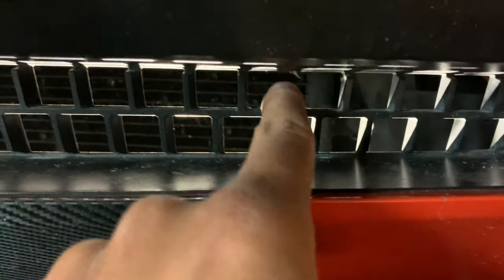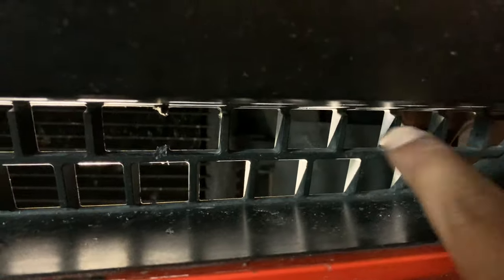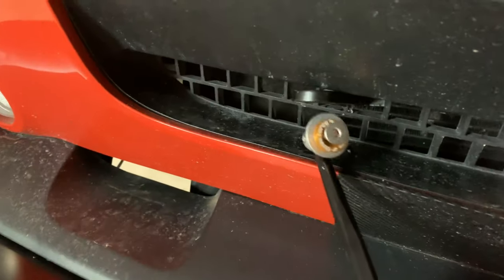What I did was I measured where it was gonna bolt up to the bumper support and I made sure it was even. For mine it was six of these little riblets in from the outside, and here you can see where I have it mounted up. From there the support rod will mount to there and mount to the splitter. I'm upside down here - there's the bracket. I held it up, made sure it was even, put tape underneath and sharpied where to drill the holes on both sides.